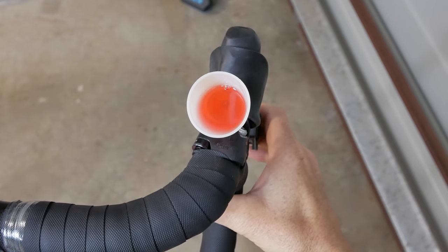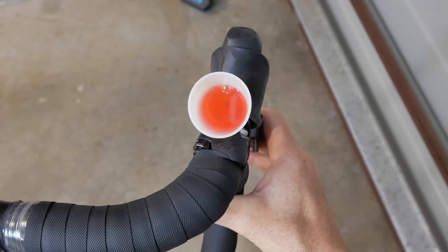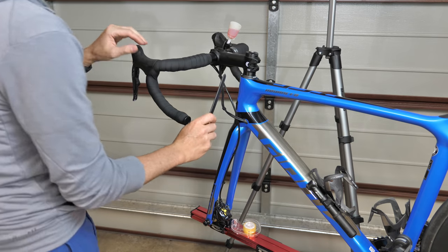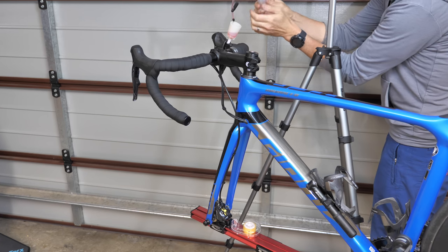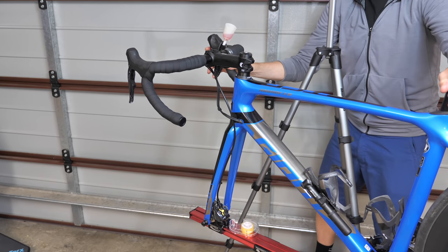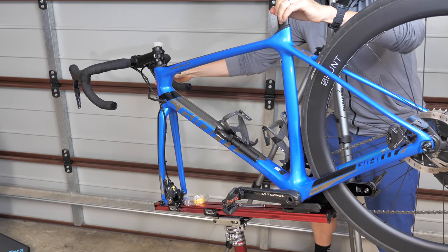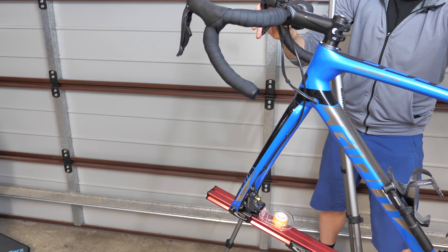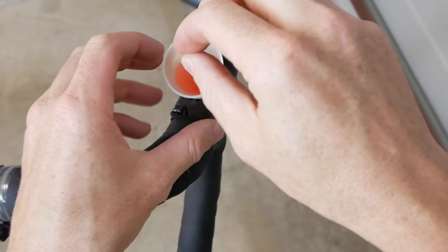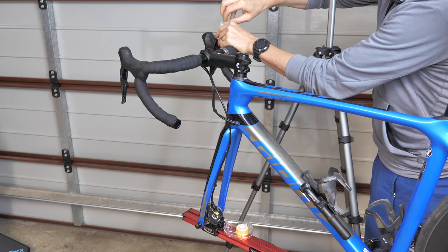The test is to squeeze — and there we have it, a little bit of air coming out of the system. Tapping some air bubbles out and removing some fluid from the cup so I can push the bike forward and back on an angle to make sure it's going to have the best chance of removing all the air. Forward, a few squeezies, and back — a few squeezies there too. And we are done. There should be no more air inside the system, so the stopper plug goes back in place into the cup.